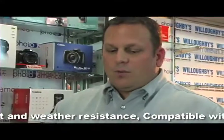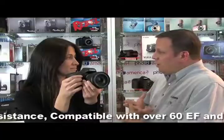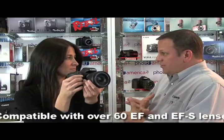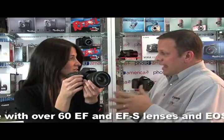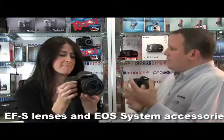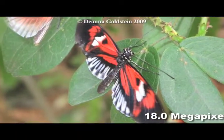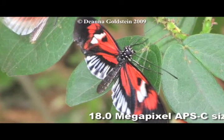An advanced amateur camera — that's really where we're placing this camera. The ISO ranges anywhere from 100 all the way up to 12,800. The camera has a native ISO from 100 to 3,200, and it's designed to shoot within that range. There are two expansions: 6,400 ISO and 12,800. In video terminology they would call that gain — it's not a true ISO, but it gives you the effect of a more sensitive sensor.